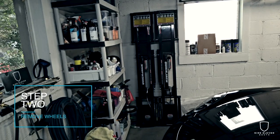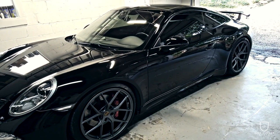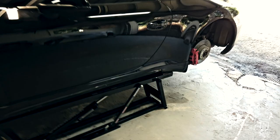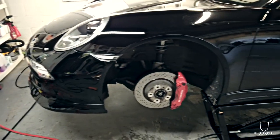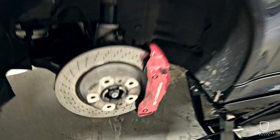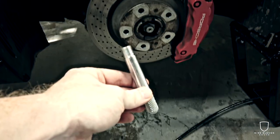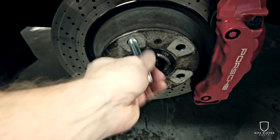I'll have the opportunity to use my new QuickJack 7000 lift, which has been a godsend. We'll get that set up, get the car up on a lift, get the wheels removed, and I'll walk you through the prep process from there. So we got the car up on the lift and took the wheels off — the QuickJack 7000 worked like a charm. One note: if you've got a lowered car, which this is with an aero kit, you probably have to jack up the front of the vehicle just to create a little more clearance underneath. Also, for those of you with Porsche wheels where the lug nuts go into the hub, there's a little stud tool you can screw in after taking one lug off so the wheel can hang and support there.